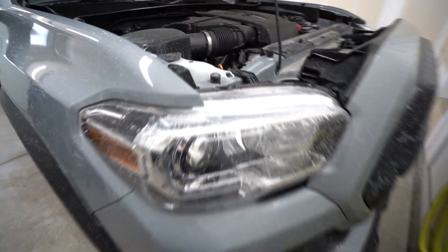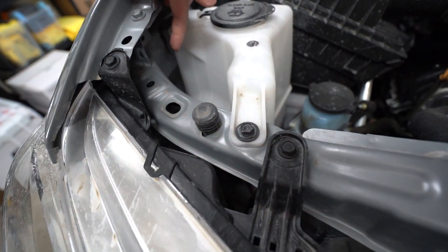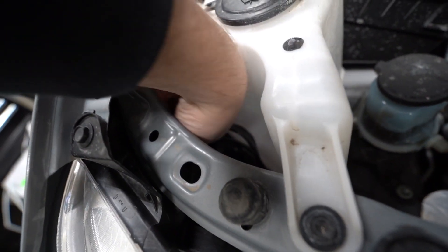The Tacoma is looking a bit dirty today, but that's a sign that some fun was had. Over here underneath the hood on the passenger side it's a little bit tighter fitting — you have to kind of squeeze your hand down here beside the washer fluid reservoir to unscrew that light bulb. All you have to do is twist and it will pop right out.